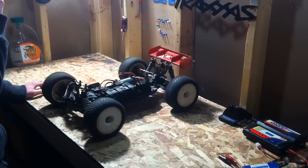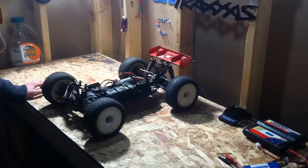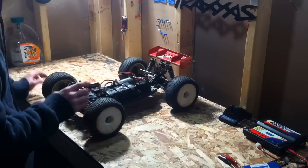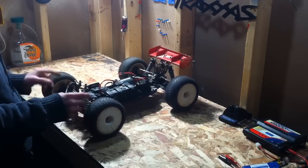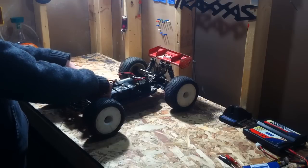You can sell the nitro stuff to somebody at the track after you swap over. Also watch out for these ball carriers and hubs here — they'll start to get loose after a bit, so keep an eye on those, and same with the steering.